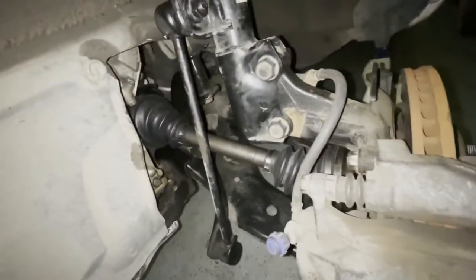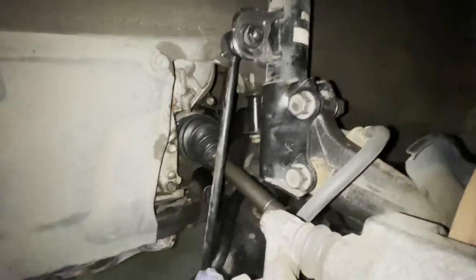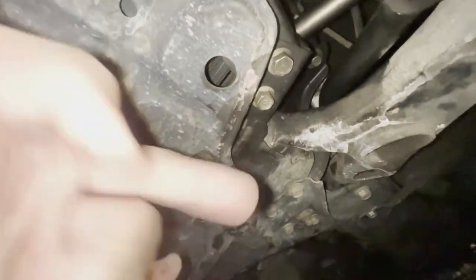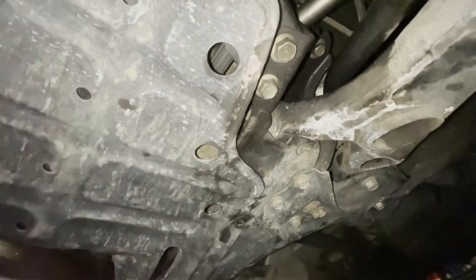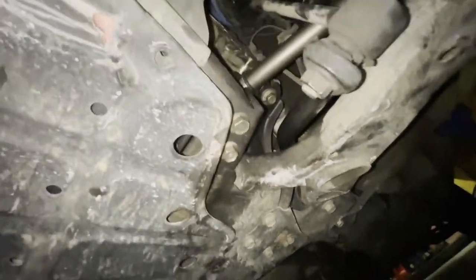You can see we have the new axle in there on the other side. It's kind of tight in here so it's hard to get a pry bar in. Basically what I did was go through a little space right here — you can put a pry bar through and just kind of whack the axle out with a mallet. There's a little groove on the axle you can get some grip on.